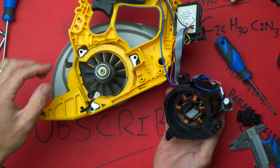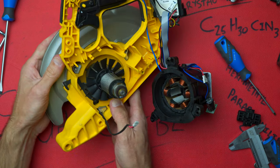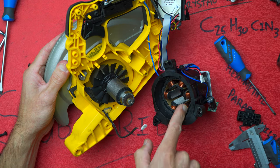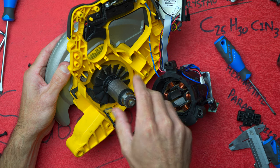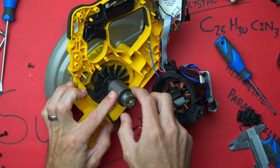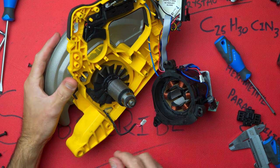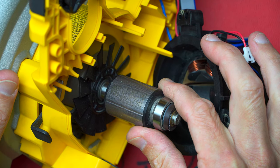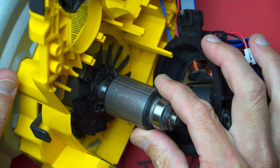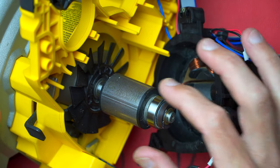As for the armature — well, in a brushless motor this would be called the rotor. That would be the stator and this would be the rotor — just a permanent magnet, four pole permanent magnets: one, two, three, four. And a small little bearing in there that's going to be supported in the bottom of the case. There are some markings on the actual rotor: N425248, 042718-47U9A — basically just part numbers.